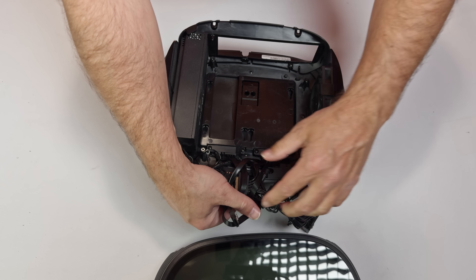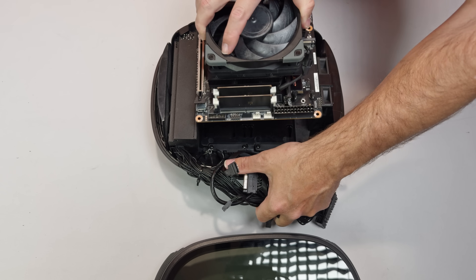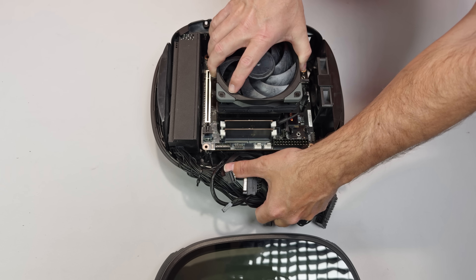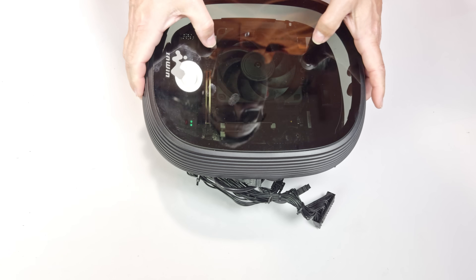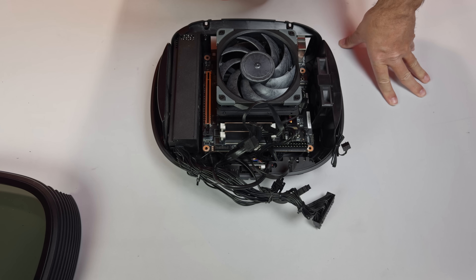With a standard 25mm thick fan, the BD795ISE comes in at just 62mm thick, so it will fit in most of the slimmest ITX cases out there — even HTPC cases like the InWin B4, though the mesh top version of the B4 would definitely be the better choice for airflow.